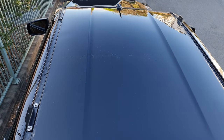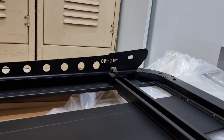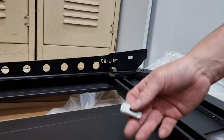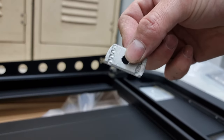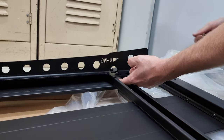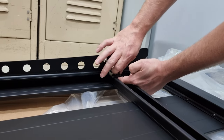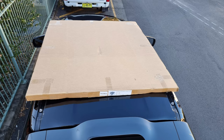I've now installed the mounts with the uprights towards the outside of the vehicle. I'm now mounting the backbone rails to the roof platform. What you want to do is slide the channel nuts into the channel, hold them up with your finger, and run the bolts through the top. I'm only doing them finger tight at the moment, just in case the rails need some slight adjustment to suit the body mounts. Because I'm doing this myself, I've used the packaging cardboard to protect the roof when you put the platform on, just in case of minor scratches or dents.